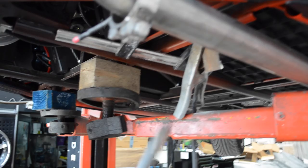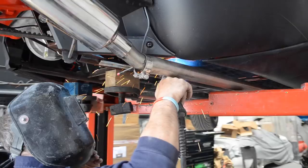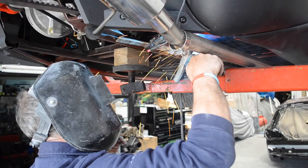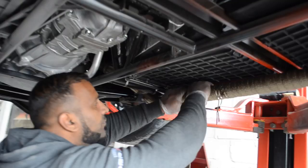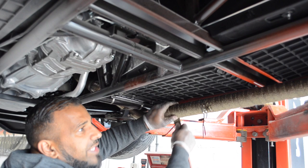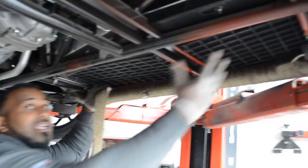Just fixing the last bracket onto the exhaust to the chassis. I'm just going to weld up here. I'm now installing this titanium heat wrap to ensure that no heat transfers through to the plastic chassis. The floor you see here, literally, is the only thing between the driver and the floor of the car.